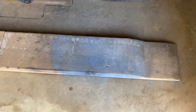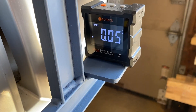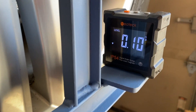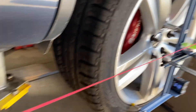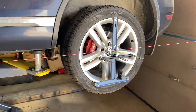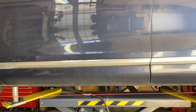Looking at it here — that'll get me my initial reading. Same thing again on this side; that tells me the camber, because the frame is made absolutely straight and welded on the back, so everything is absolutely perfect. It's very, very stable and does not move. I've got two others for the other side, so that gets my jig absolutely working. Stand by for some more.